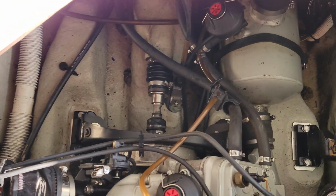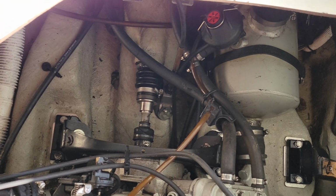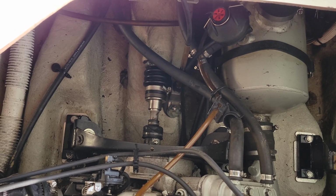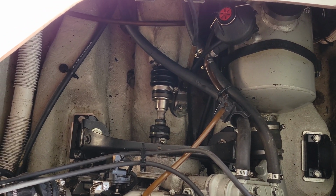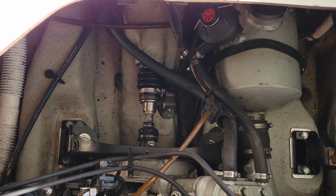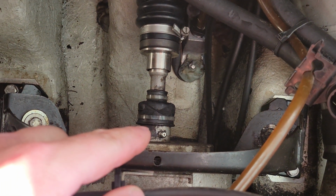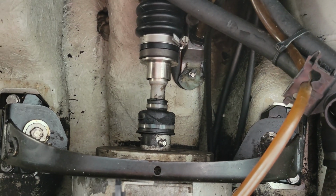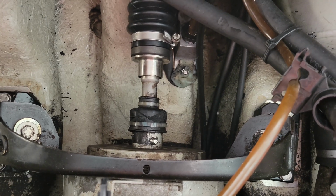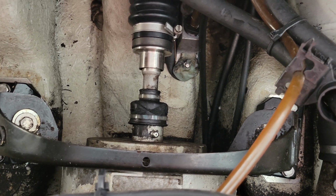One quick thing that I have to do, you'll notice sometimes when you guys have these jet boats that the impellers start getting real loud and sound like loose, rattle a can, just sound like crap. And actually a lot of times what that is simply grease being worn out inside your drive shaft. So you'll see there's a nipple here. There's two ways to service it, two ends to service. There's one on the jet pump side where you have to fill it up and make sure it's solid full of grease, and then there's this side.